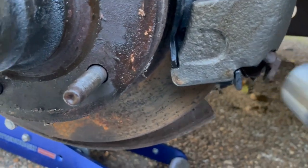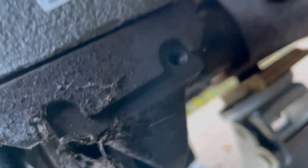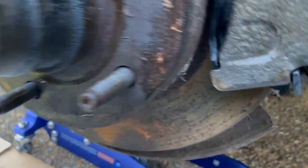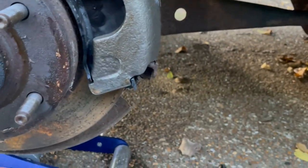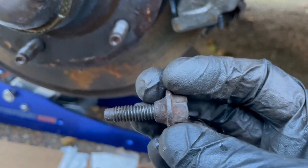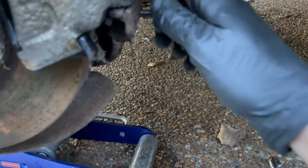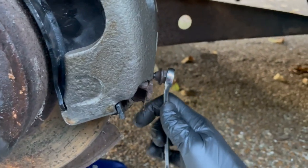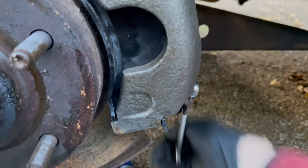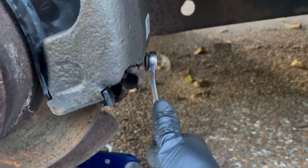Tapping it in just a little farther until it's fully seated. I didn't slam it but it's nice and tight, and that's what you want. Then you take this bolt - it's a special bolt, see how it's got a weird head on it so it doesn't bind anything up. You just screw this in and tighten it up with a 14 millimeter wrench. The idea here is not to make it crazy tight - it's not supposed to be torqued to 80 pounds or anything like that, but it is tight. You don't want this thing coming out.